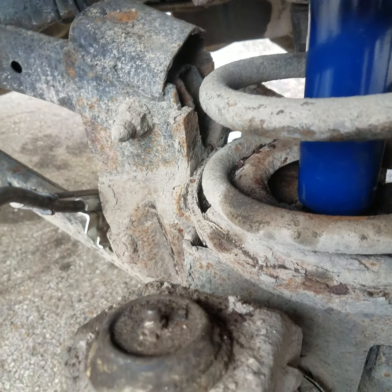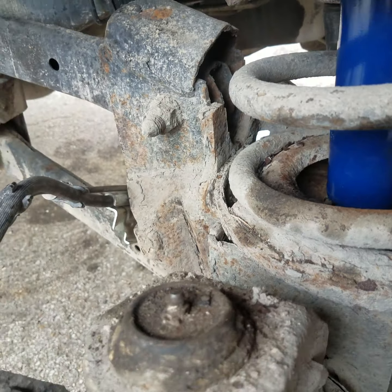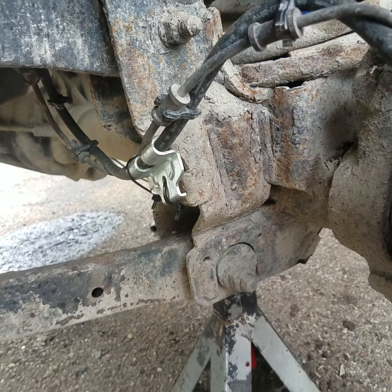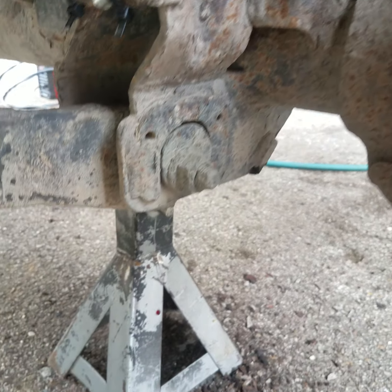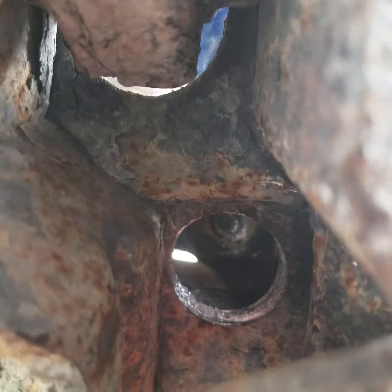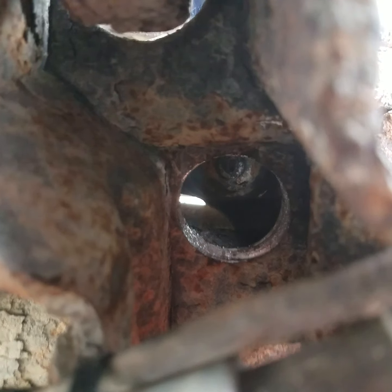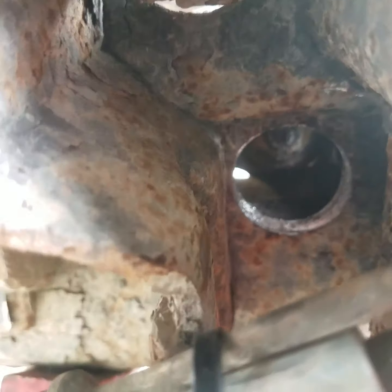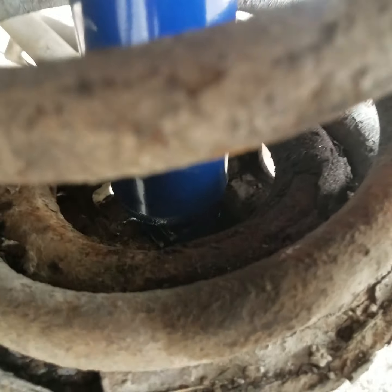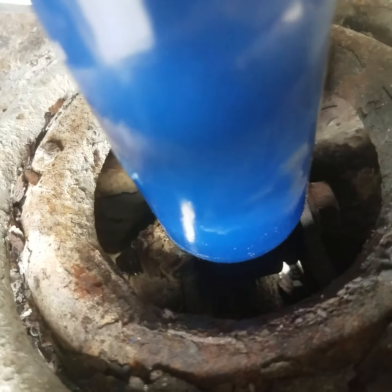Second option if you don't have a welder: go right in here on the right, behind the axle where the brake caliper line and ABS sensor is mounted. Undo that mounting bracket. Right in behind there, there's a hole in the frame rail — it's only a seven-eighths inch hole. If you take a hole saw kit, your standard inch-and-a-half hole saw, and redrill the hole bigger, you can get right in to that slug on the base of the shock. Get in there with a nut extractor on a socket, then go back to the front side with your impact — it'll hold the slug in place so you can undo the bolt from the front.